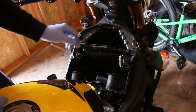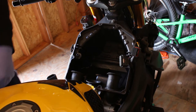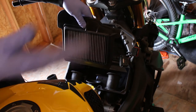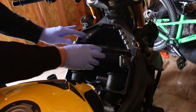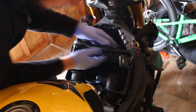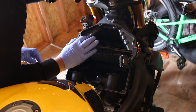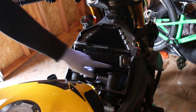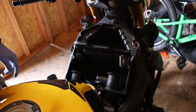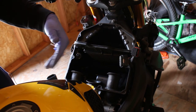This is how you access your air filter — the inside of your air box. Just pull out the cartridge and put a replacement in. This is the same air filter, just for demonstration purposes. With your air filter, you want to squeeze it in there, push it in, make sure there are no gaps, make sure everything is sitting flush. Also make sure there are no contaminants inside any of these. Once you've got the air filter in, you're pretty much done — all you have to do is redo the steps in reverse.